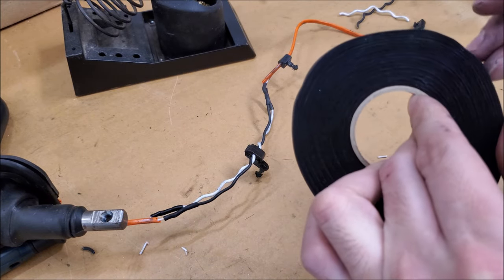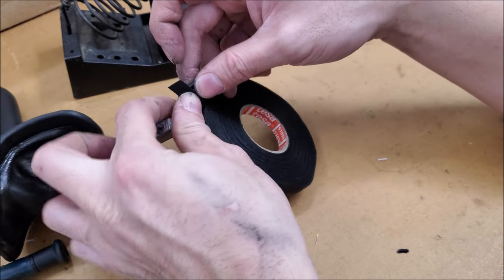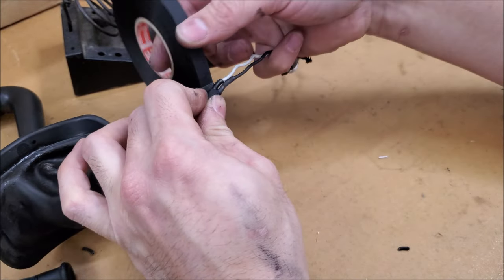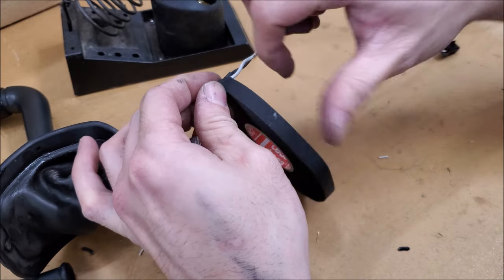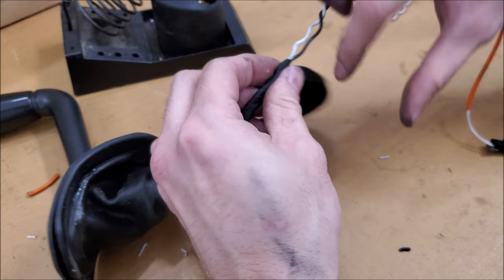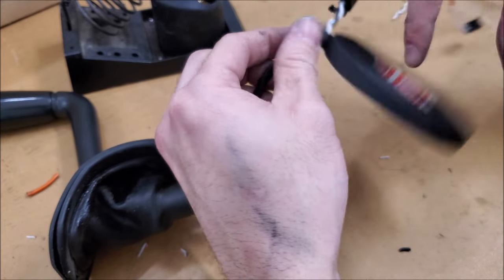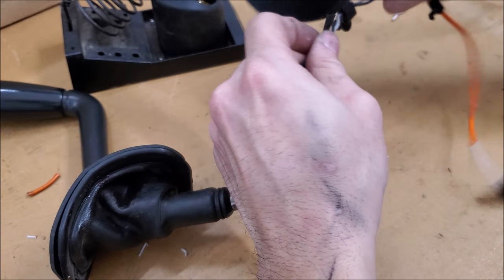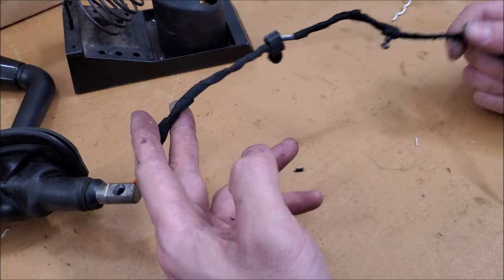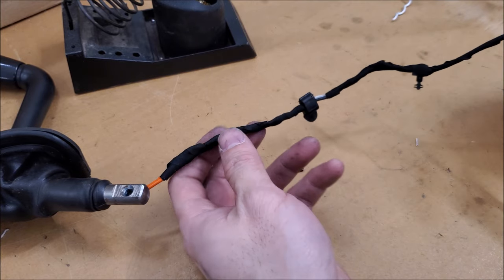It's being a bit redundant. What I'm also going to do is use exterior TESA tape because it's more durable than interior. What I like to do is keep it open like that, wrap it onto itself so the adhesives meet each other, and then do a tight wrap after that. Use something automotive rated. So here's my final fix — it is extended, it has exterior TESA on it, and we're using solder and shrink wrap with glue in it. It's going to be a lot more durable.